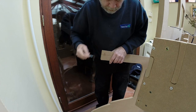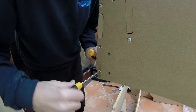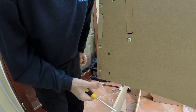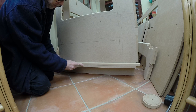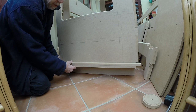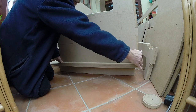Just got to do another six on this one and we've got the panel in. That's given us a really solid fixing now that isn't going anywhere. So that's the very last piece of MDF I've got to cut on this bus — I think it's the piece I'm putting on the back there, which will give me something to screw through from the inside and locate the back panel, saving me from having to fix up from underneath when it's actually assembled, because it's very difficult to get in and drill and screw upwards. There's an overhang on that side because another panel has to come out on the side of the bus, so that should be about right.